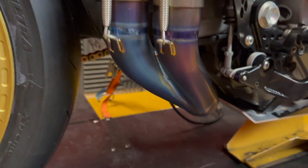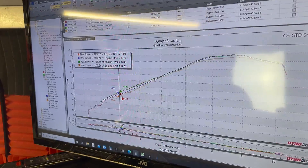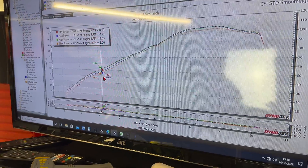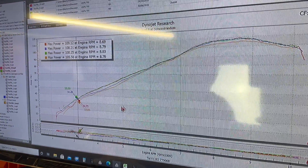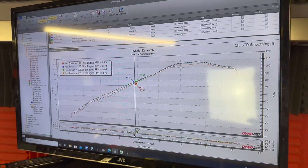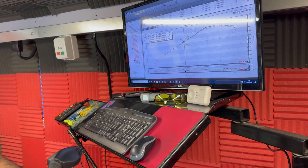One advantage of coming here is it's nicely blued up my pipes — I don't have to tank it around Wales anymore. From the map file at 4000 RPM we've gone from 45 to 48 bhp — that's three more horsepower. The biggest gain we saw is about five horsepower — 47 to 51 — so that's going to be even more crazy in that range. Anything from about 3000 revs up to just under six, you've gained a nice lump of power. And the pipes, even with the temperature gun, are at a sustained normal temperature.